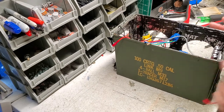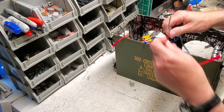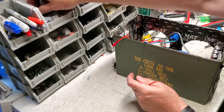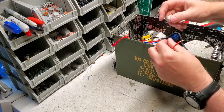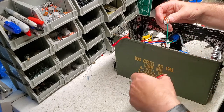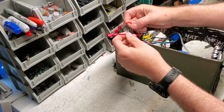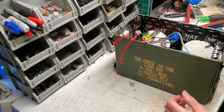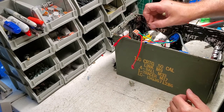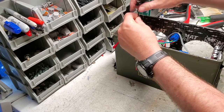Remember on the wires here - the green wire is our hot wire. We're going to tie these two together. This is going to give power to the switch, and then the switch is going to power the amp. Let's go ahead and put our nice little lever nuts here - just like that. I'm not going to hook the fuse up until we get everything ready to go.